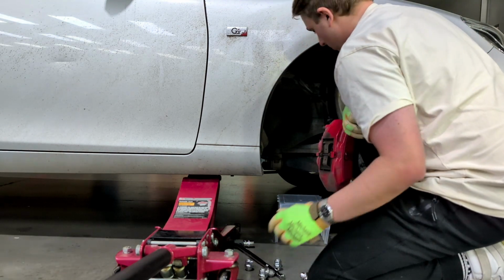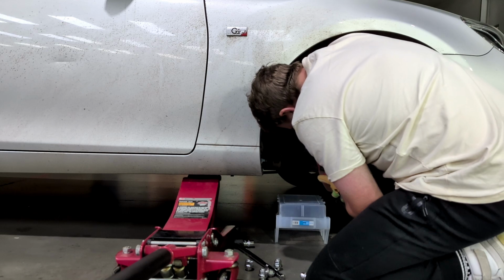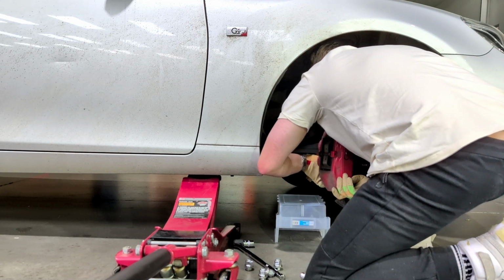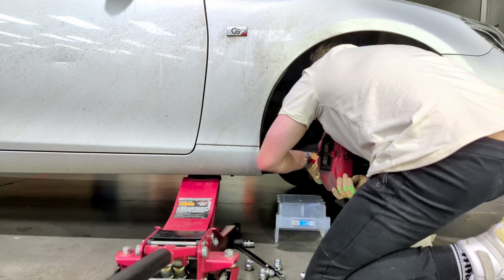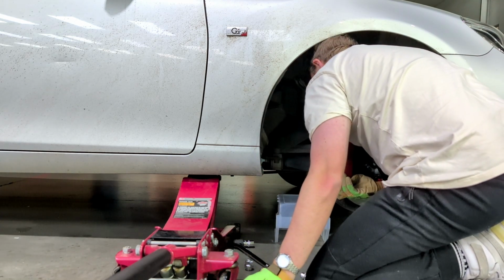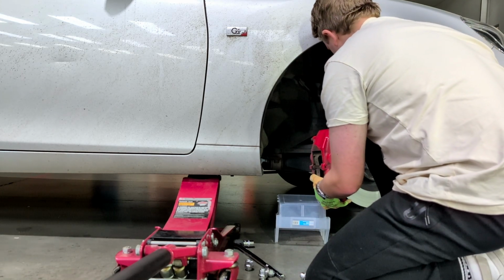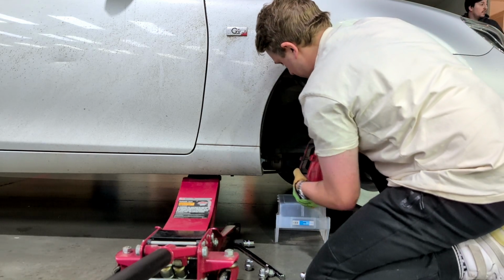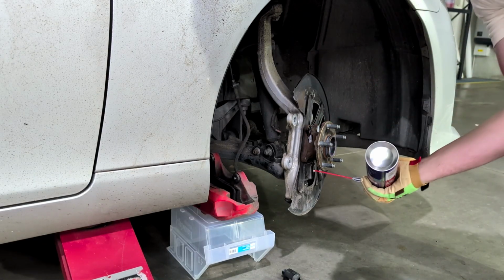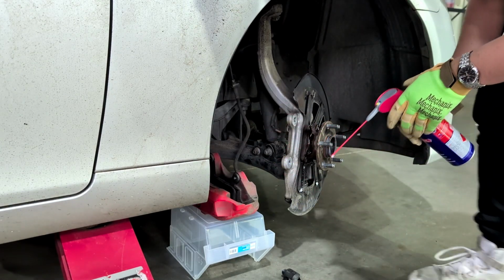Okay, so rear caliper bolt number 1. Cool, it's nice and loose. And the front pads have heaps of meat on, which is good. Oh man, cracking these wheel bearing nuts is going to be fun. Might need some WD-40 for these. I'll put a wheel nut on the caliper. I don't want the caliper falling off, because that'll hurt. You get that speed sensor out as well.